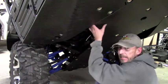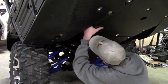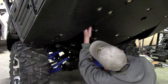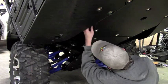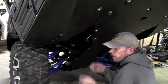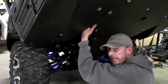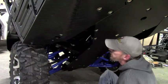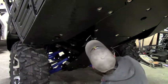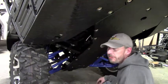Now this is the exact same installation for both sides — I'm just going to demonstrate one side in the video. On the other side there's actually a little heat shield that's kind of in the way to get this clamp in there. You can see the clamp will just fall in on this side, but on the other side there's a little bit of a heat shield. It's super easy — just pry it slightly, bend it out of the way to get your clamp in, and then you can bring the heat shield back. No adverse effects whatsoever. That's just about the only difference between the two sides.